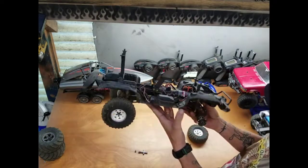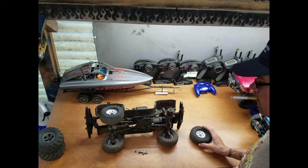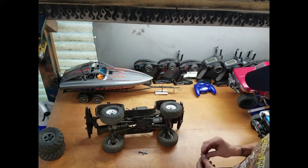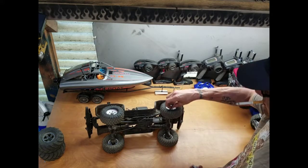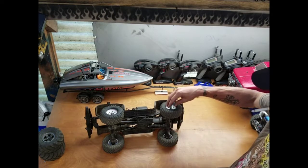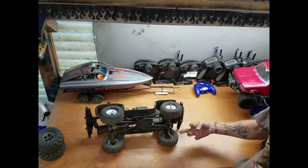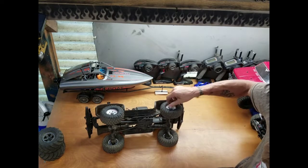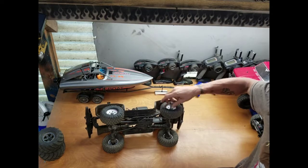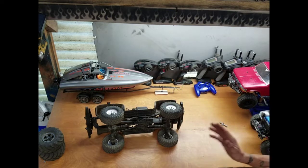The STRC brass knuckles are 71 grams — they fit perfectly and it's really easy to change them out, just a matter of minutes. Just take the kingpin screws loose, steering linkage loose, dump the whole portal and axle assembly out on each side. Six screws on the back, two on the front — as you've probably seen in everybody else's YouTube videos — and then one for the hex keeper.